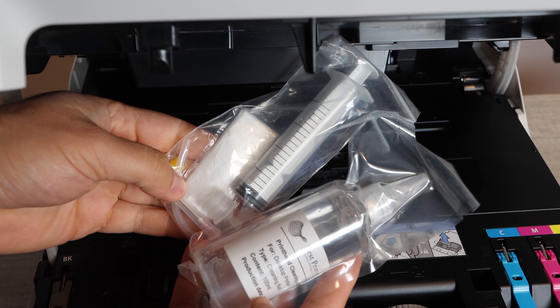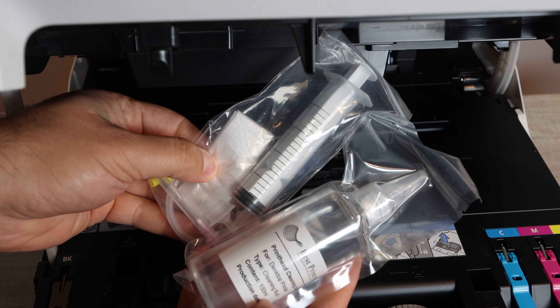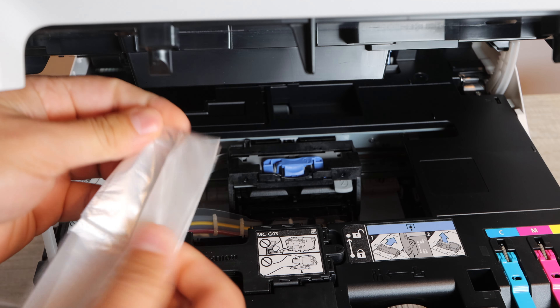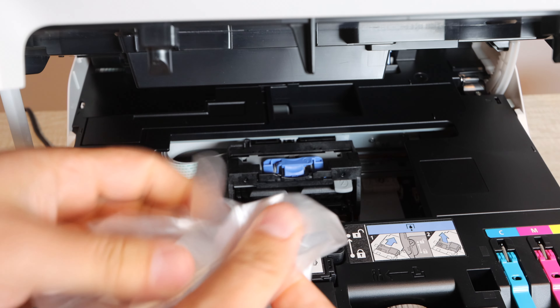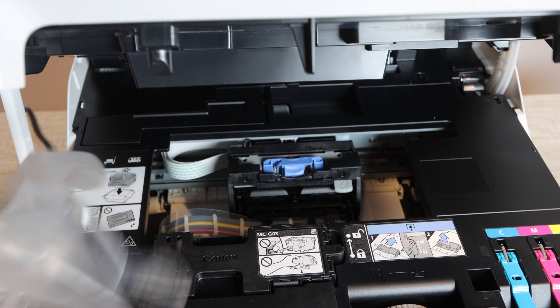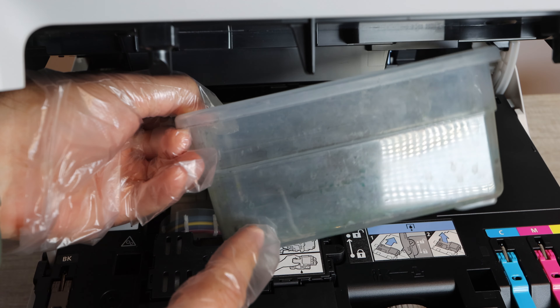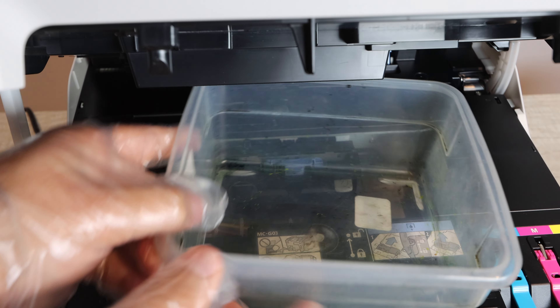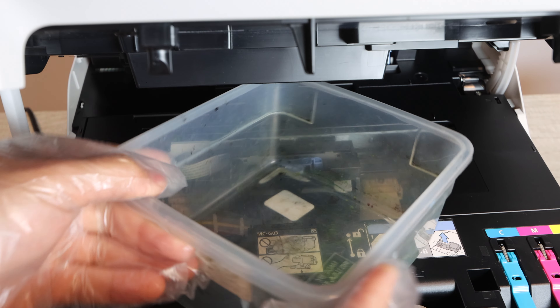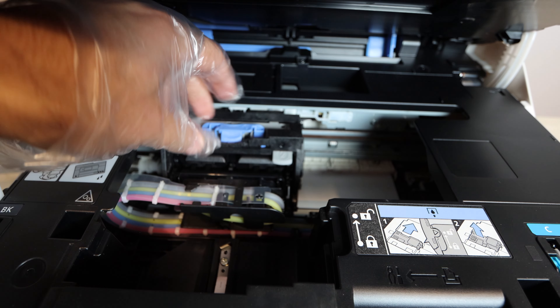We can move it into place, and this is where the best printers cleaning kit comes into play. If you haven't already, click the link down in the description below so you have it coming on the way. In this case, with this specific printer, you're going to need a small plastic tub that is deep, because you're going to be using this to actually clean the print head. We're removing the maintenance box right now so that we have better access to the print head.